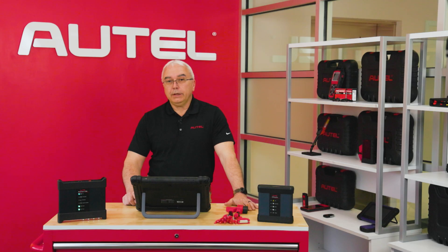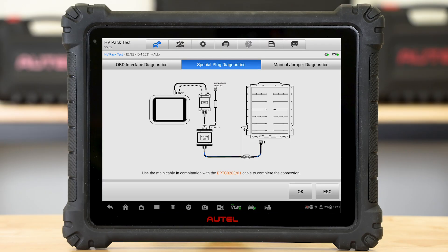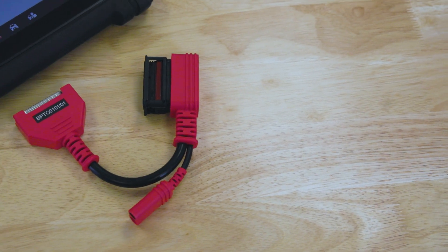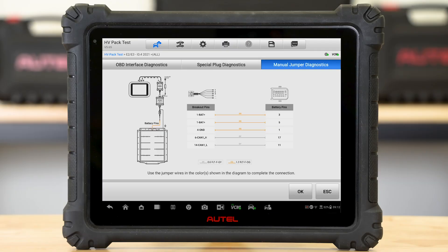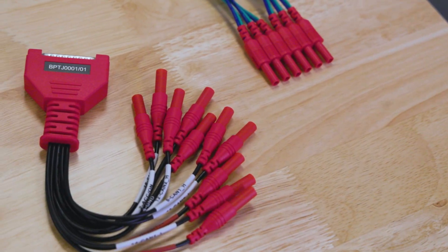At this point, we're going to be communicating with the vehicle. I have a choice that comes up — three options. One option allows me to go directly to the OBD-II connector, which is great if the vehicle is there and you're just trying to perform regular diagnostics. We also have two other options. One is called the special plug diagnostics, which gives me the part number of the OEM-style plug for this particular battery pack so I can quickly unplug from the vehicle and plug directly into the battery pack. Or I also have a manual jumper selection — for any vehicle that may be too new to have a specific cable, we give you the options of using the universal pinouts.